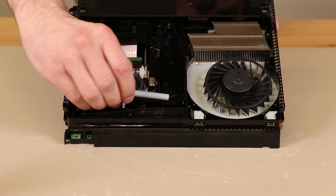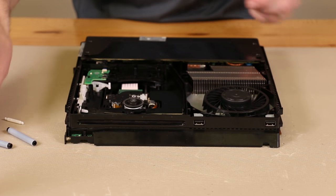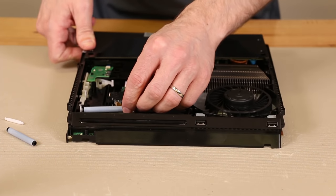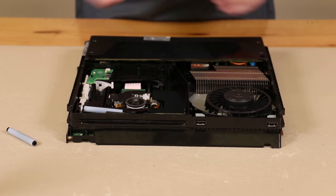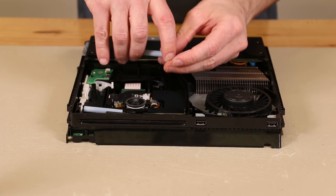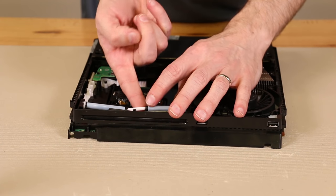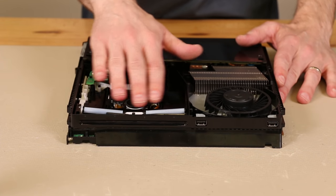I'm just going to pull up on it and this will get the rollers out of place. So these are the rollers — this is what they look like. And then this is the connecting rod. To install them correctly, you need to install the right end first. It's got three grooves in it and they just fit into this gear right over here. Once it's correctly in that gear, then you can just take it and snap it down. Then you install the next one. You install the connecting bar right there. Then you want to put this end first over here and connect the connecting bar into the other side of the other roller. And once that's done, you can push it back down into its space and it'll click into place like so.